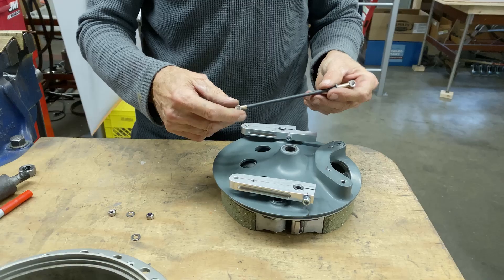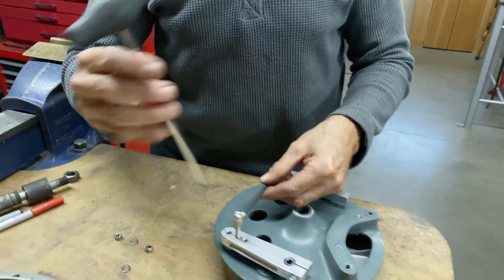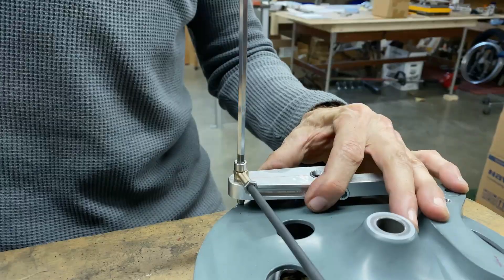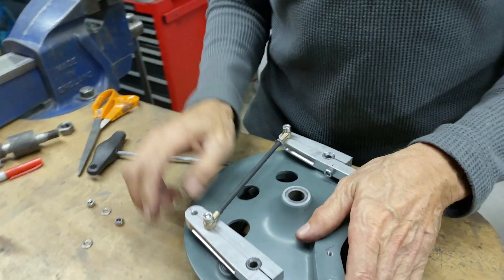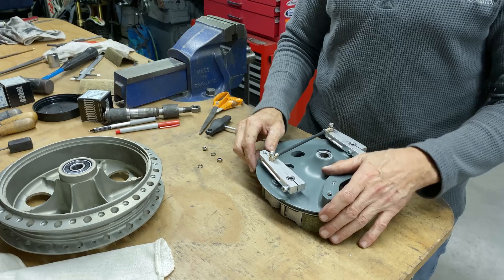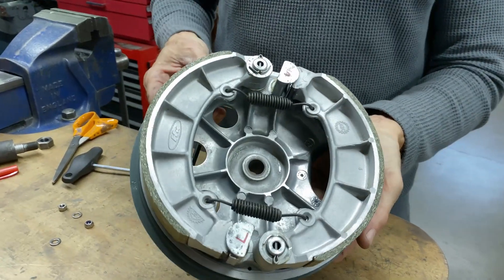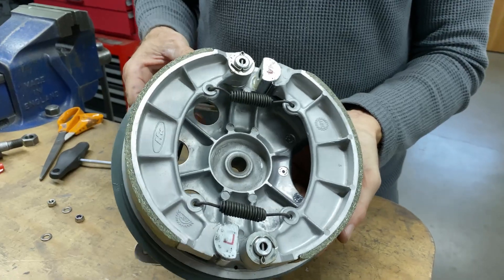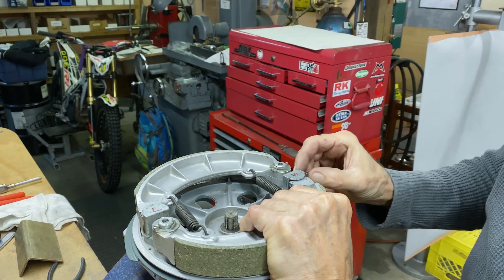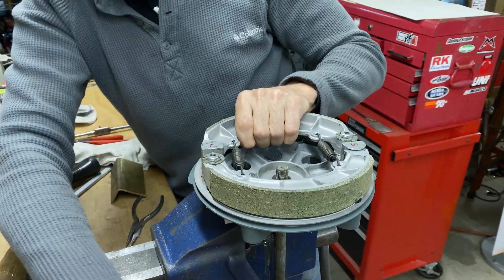This is that linkage I made. We'll put the first one in and then move the screws so that the holes line up. That seems to line up pretty good — look at that. The brake lever and the cable bolt to here — that's where the cable stop is. So when I pull the brake, that's what happens. See how it opens the shoes — that's how it works. So this is where the shims come out now. One set of shims and three sets of shims.